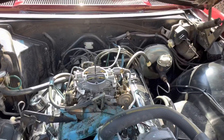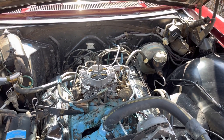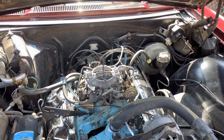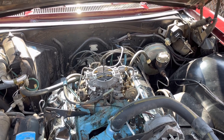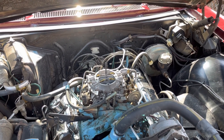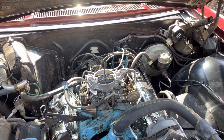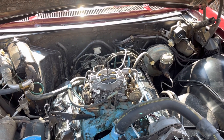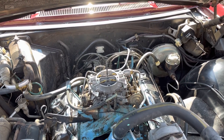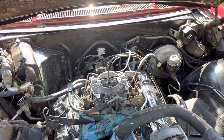The problem too was I was stepping on the gas, it was stalling, and I couldn't restart it because it's so cold out. It's too lean — I couldn't get any discharge out of the fuel nozzles to help with starting. So I had to manually close the choke to get it to start, kind of embarrassing, just as I'm road testing it on my street. But now all is fixed, and I was able to put a few gallons of fresh gas in it too — drained the tank, put fresh gas in it, and now it really just purrs.